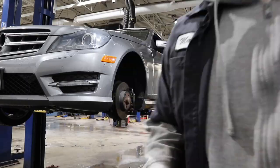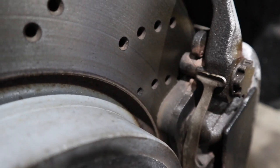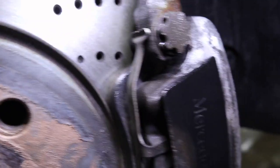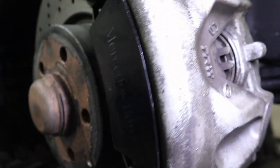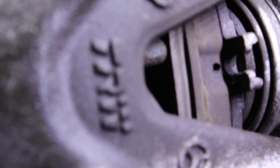I'm going to show you guys how to measure the life of your brake pads specifically. The first thing I do is take the wheel off and see if I can look at both the inner pad and the outer pad. On your caliper there's actually a little slot that makes it easy for you to look in there and see the life of your inner brake pad.